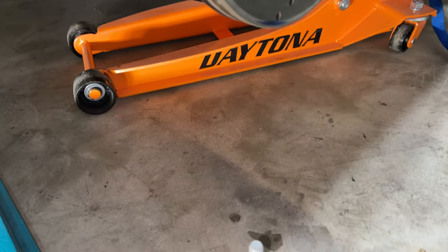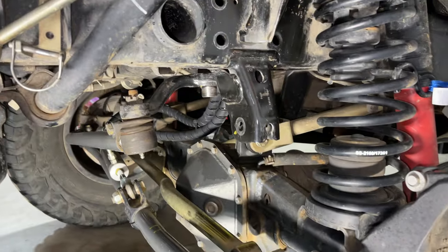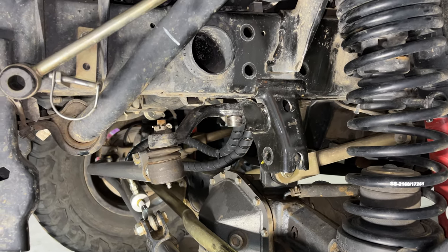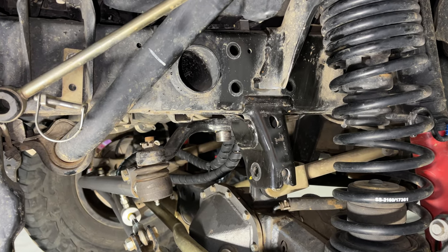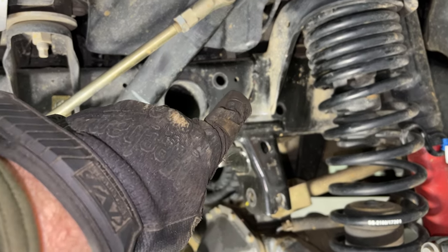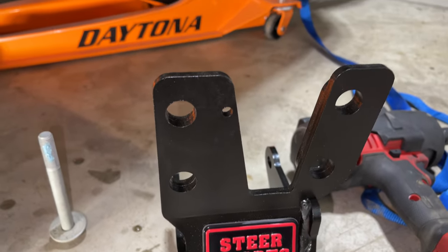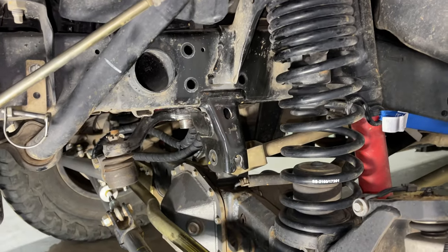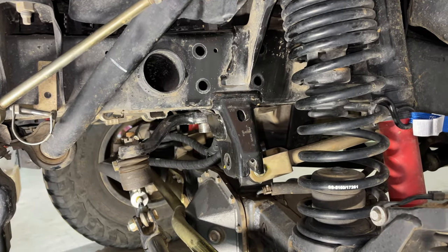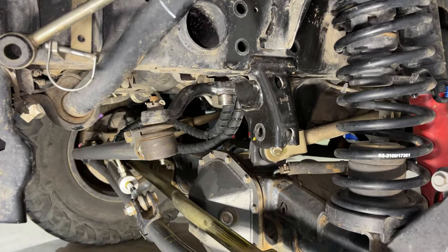Once that sector shaft is cleaned up and the mount area is prepped, I threw some blue Loctite on the bolts. One thing to note: the steering box will have shifted down from its own weight when unbolted, so you'll have to hold it up while lining up the bolts — it helps to have a friend, but you can do it solo. On some models there's a wiring harness that pokes into that hole — you'll need to move it into the hole the bracket provides. Also, if you have a Mojave, there's some trimming needed on the coil bucket so the bracket fits. Let's get those bolts torqued to 99 foot-pounds.